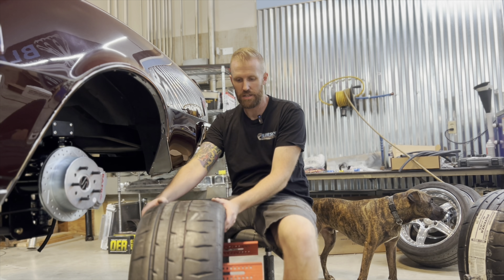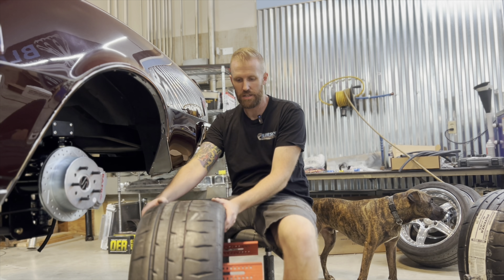Now that I have the front wheel off, I'm going to take the coilover out just like the rear — that way we can get the suspension up into full articulation. The front is extremely important being that it's a turning axle; you're going to have a lot more clearance issues on the front, so it's very important to remove the coilover to get full movement out of the suspension. Now that the coilover is out of the way, we can get this thing bolted up. The tool is currently set to four inches of backspacing, however our old wheels were at four and a half inches, and I had a suspicion we'll need about a half inch more — so we're going to move this in an inch, giving it five inches of backspacing.